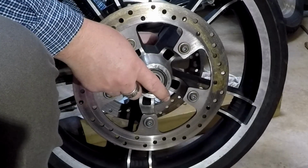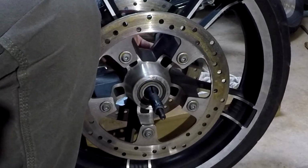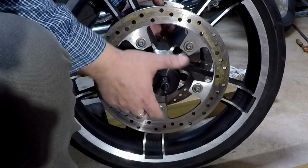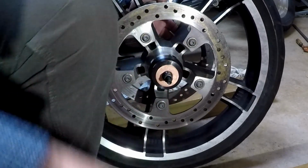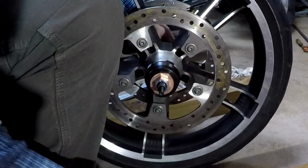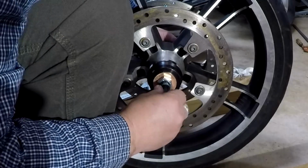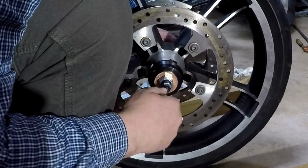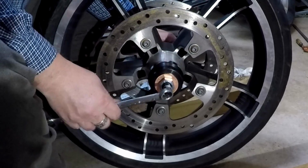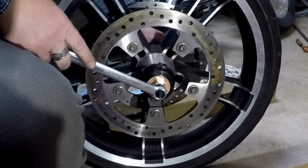All right, with that center bolt in, and I got on the other side, I got my 5/8 Allen in there. And go ahead and put the spanner on, copper washer on, and put my nut on. Okay, that's on, finger tight. I'll put this little washer on, put this nut on, and when you tighten this down, you want to get it tight because you want to spread the inside of the bearing puller out so it has a good bite.